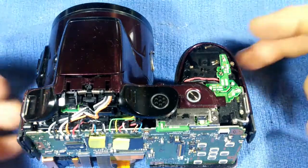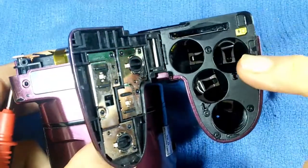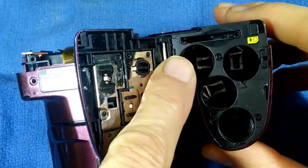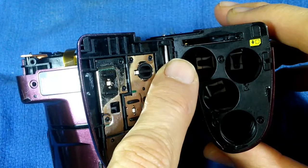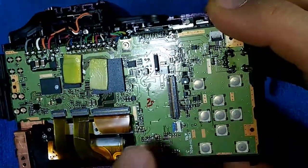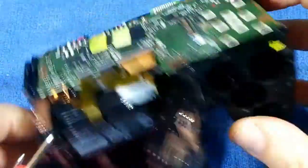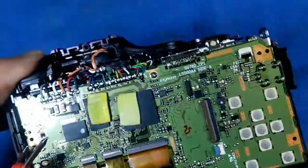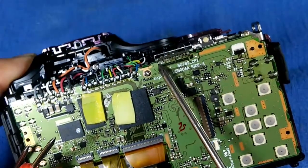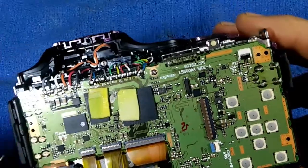It is not apparent at this point why the camera won't turn on. Looking into the battery wells, the contact at the bottom of one well is the minus terminal and the other is the positive for all four batteries in series. You would think there would be continuity between this terminal and the ground points on the main board, but there isn't. Using my ohmmeter, I do not find any continuity — which is curious. I do find continuity to a different ground point. Is it possible the ground line has been broken somewhere?